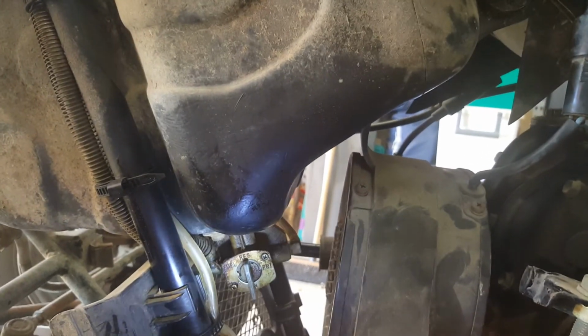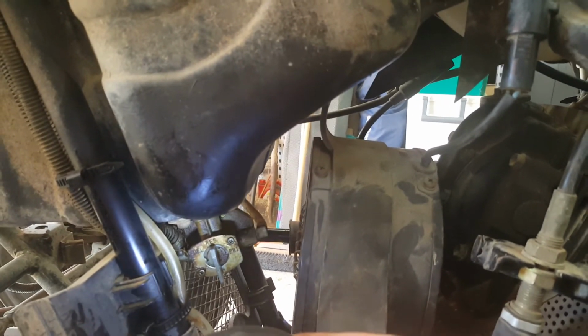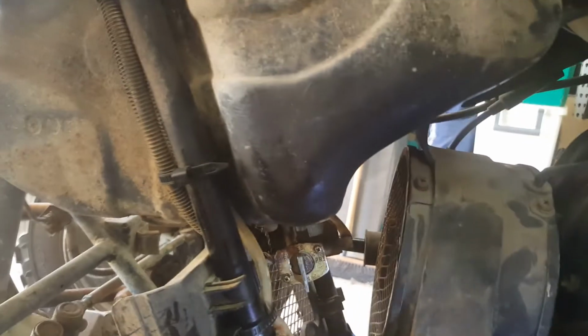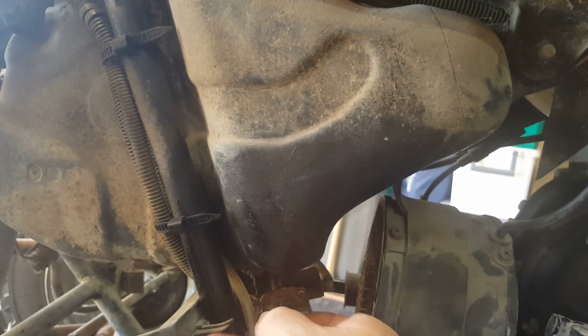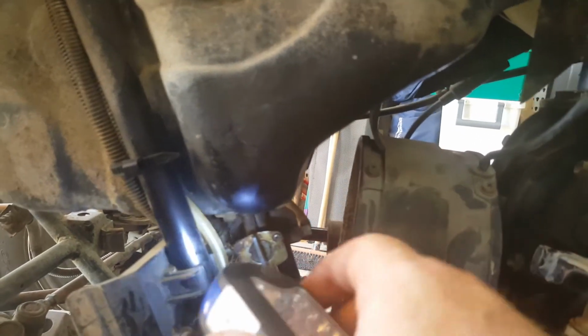So the carburetor's got to come off again, and the new needle and seat checked to see whether it's shutting off the fuel. I don't suspect it is. You can test that by just blowing through the fuel line, or where the fuel line connects to the carburetor, and tipping the carburetor up so that the float valve is operating, and it should stop the air that you're trying to blow in from getting through. So I didn't do that when I was doing the carburetor. I need to do that when I take it off.